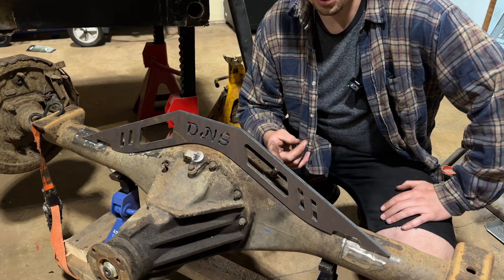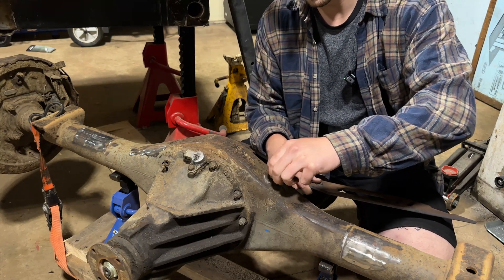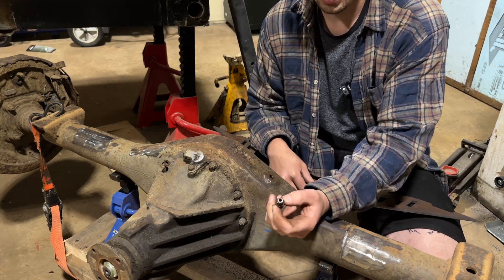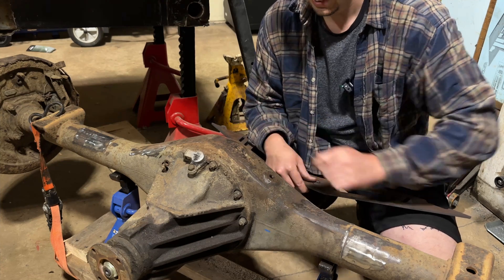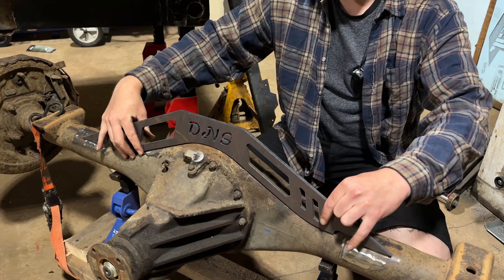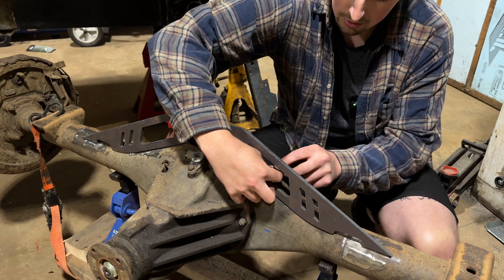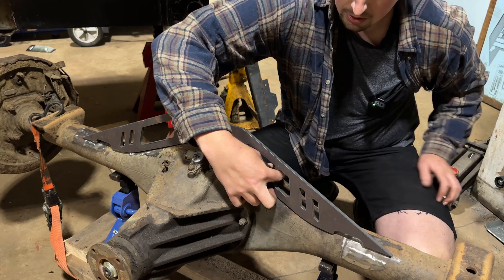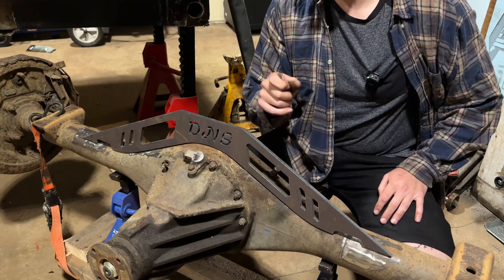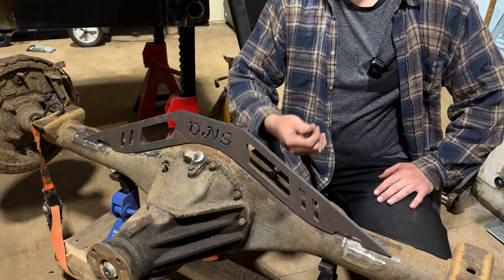Something that can be incredibly annoying on Samurai axles is the fact that the diff breather is just integrated directly to the housing. The fact that I can just unscrew this and replace it as a barb fitting is just amazing. That's why I put this larger speed hole or gusset hole here, so that when I have the axle truss assembled I can still get my fingers in here and assemble this diff breather if we ever have any issues with it. If this breaks off or I have to replace it, it's really easy to access. I'll do this on the other side of the axle truss as well, and I'm going to put a little access hole on the top so I can run my hose out for the diff breather and run that up the link tube.